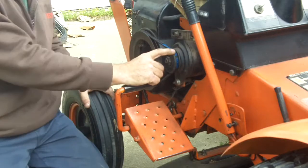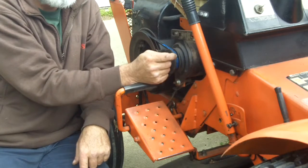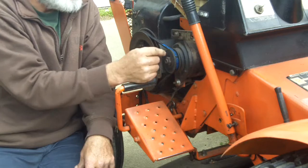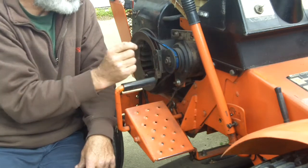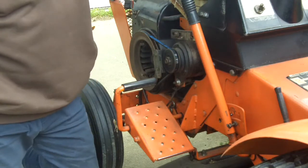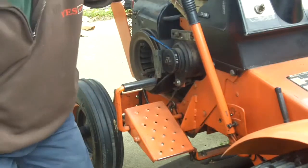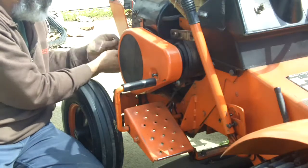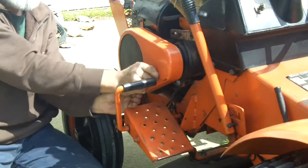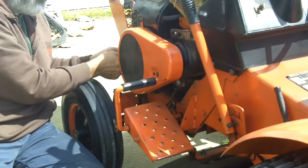It's a really unique setup on this machine. This is an old Delco Remy — it's like a starter that was in an old V8 Chevy engine. When you put power to it, it'll turn the engine over. You take power away from it and spin it, it generates power. So it starts the engine and charges the battery all in one unit. Let's just leave that plug wire off until we're completely done with everything and put that back in gear so it doesn't end up rolling.